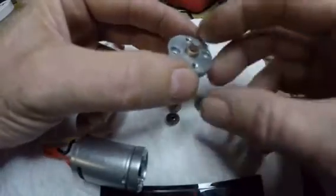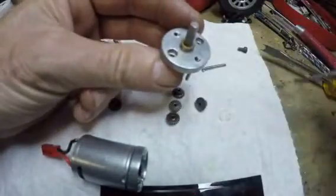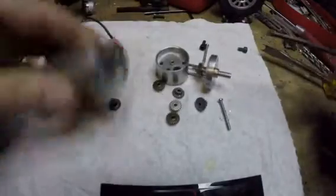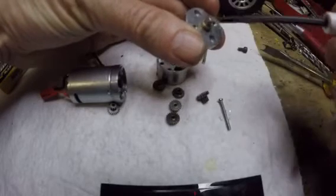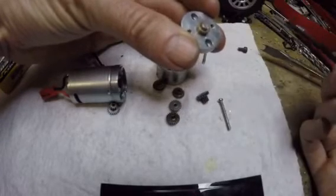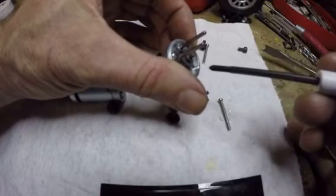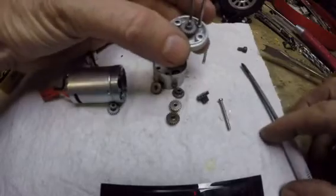So what I wanted to do — and the reason I screwed it up in the first place — was I took it apart and I didn't know what I was doing when I put it back together. I wanted to drill these two holes out here. These holes with the counter bore are for these long screws, and that's what holds it together — it goes through this and screws into here and here. So I wanted to drill out and re-tap these two holes to standard 6-32, and this one I've already done. It's just barely big enough. You don't want to torque down on it. You can see the tap was right into the side of it, and it shouldn't make any problem. Make sure you clean out the filings so you don't end up with a bunch of crap in there wearing out the teeth prematurely.